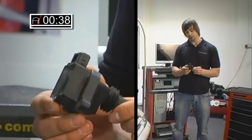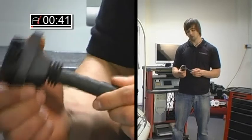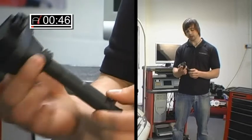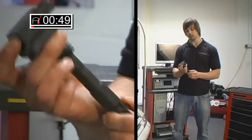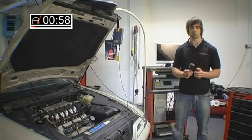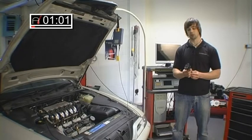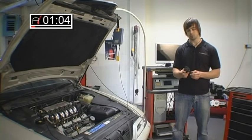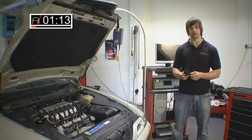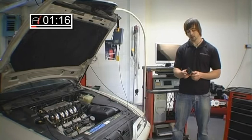We get a lot of problems with ignition mainly due to the coils breaking down, but a lot of problems can also be caused by dirt ingress and the environment they work in, such as heat. What it does is damage the insulator, which starts acting as a conductor over time. Once you get a slight misfire, the condition will only worsen — you get poor fuel economy, hesitation, poor performance, and the more severe problem of unburnt fuel going into your catalyst, which can get damaged, leading to MOT failures and poor emissions.